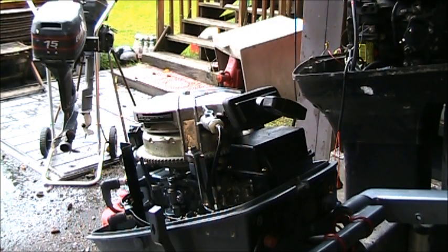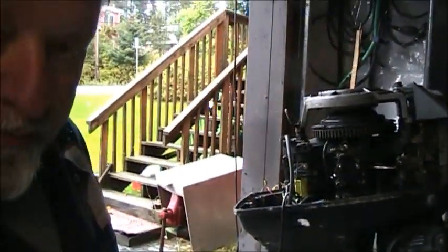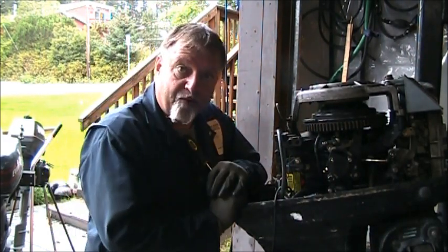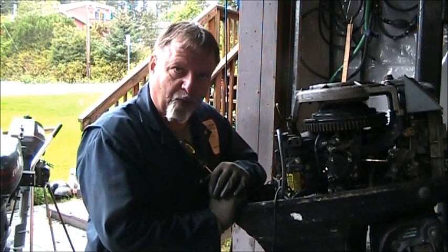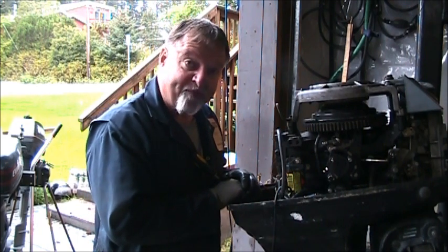Now, getting back on this 55 commercial. I did not even see it. Maybe I was still, when I first started this thing, paying attention to the discharge from the P-tube, but a very observant subscriber put a comment down below on my last video and said, hey, did you see the water squirting out right around here in the middle of the head? And sure enough, I watched the video and there was water squirting out of here. So we had to pop its head off. And that's what I did. Yeah, I popped its head. I popped it like a teenage pimple.